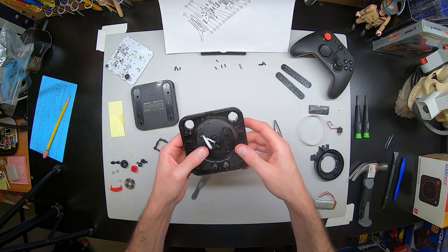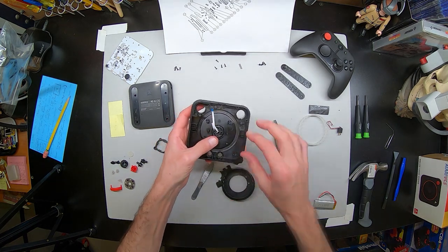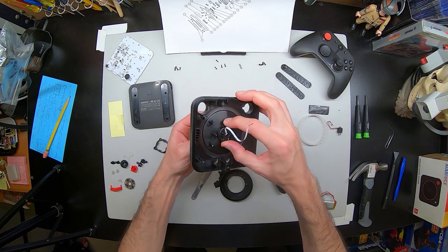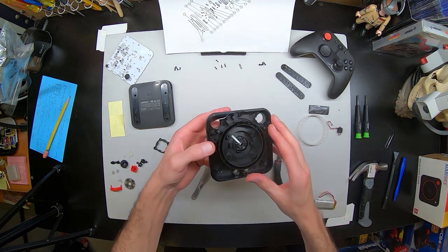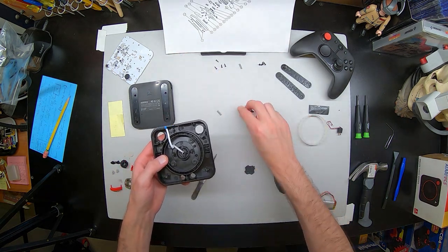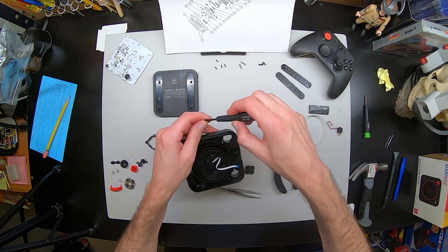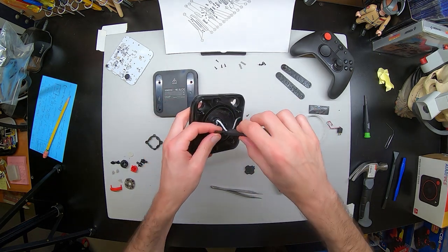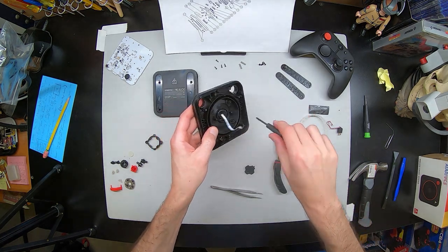So there we go. This is, of course, the light bleed cover. The ribbon cable goes through the middle of the light ring. It ingeniously locks under those little tabs — only one way. So if it's hard and you're trying to smash that in, slow down, lift it up and slide it down in there, because it really goes perfectly and simply once you have it right. Plastic screws again — these are the Phillips number 1 by 25s. The last screws you would have taken out are these four. Remember which set you took out in the order you put them in because they are all a little different. I get a good grip and put on the final cup piece. We can slip in the light ring — make sure it's down in there all the way.